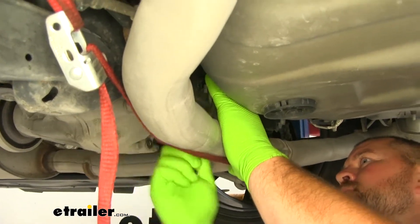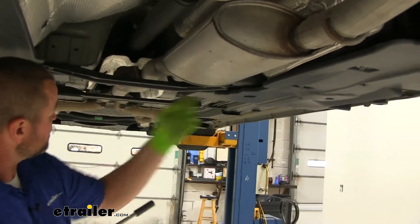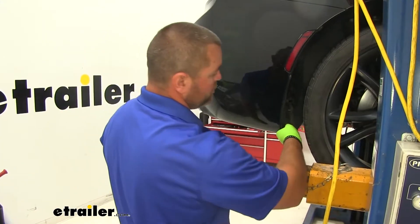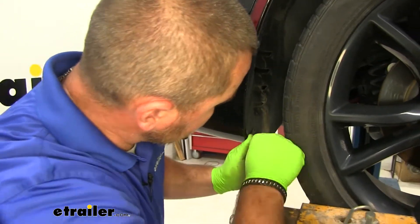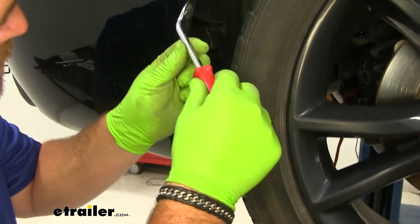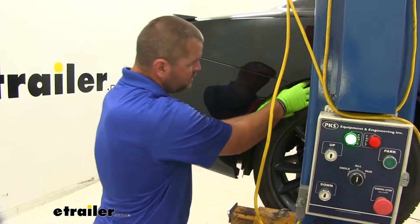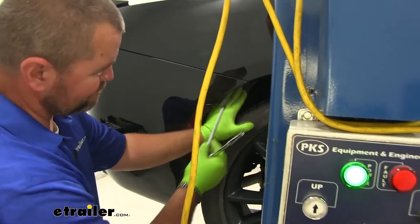We'll have one more here. Then using a half inch socket, we're going to have two cross braces — there are two bolts on each side of each bracket, and we're going to go ahead and remove the brackets for now. We're going to set them down. We're going to have three push pin fasteners inside each wheel well. We're going to pull those off using a flat head screwdriver or trim panel tool if you have one — you pry out the center and then the base. There's also a 10 millimeter head bolt right up here on the inside.